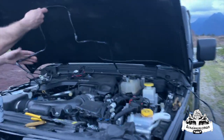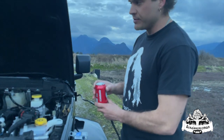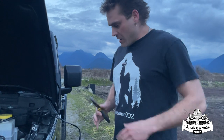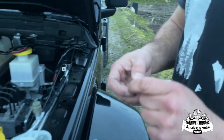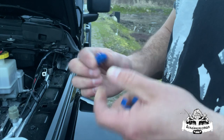Now we're going to stretch it out and make sure we have enough to reach across. So these two pod lights have two separate wires. Luckily on the other side the two pod lights are connected into one wire, so that's going to help us out a lot. We don't need two big wires running across the engine bay, so we're going to cut this one short and splice it into this wire here. I've really fallen in love with these self-stripping tap connectors since I used them on my resistors for my lights — they're really going to help me out with this job as well.